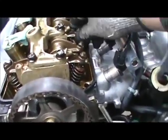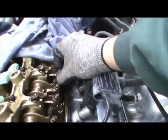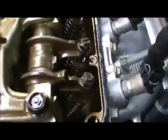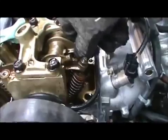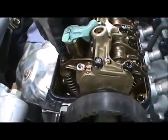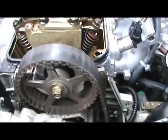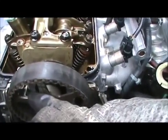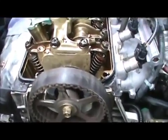See, these are loose — see how these are loose. Should be loose. These are tight — see how this isn't moving, this is tight. This is loose — see it's moving. Loose — that means there's no pressure. If you actually get close in here, you can look at the lobes to see where they are. If you look right here, that's loose — it's loose. So on the intake it's loose, on the exhaust it's loose. That means basically it's on the compression stroke. Just put this up and make sure these are loose — that way you know it's on the compression stroke.